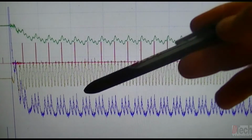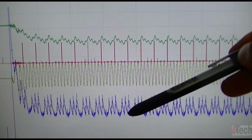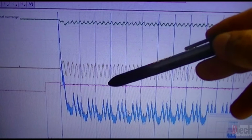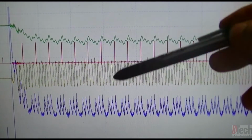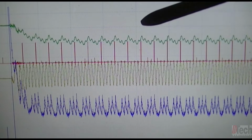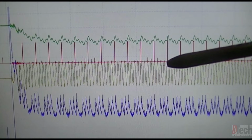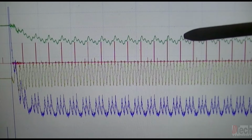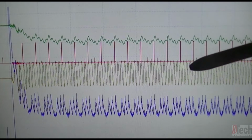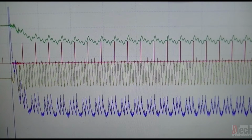Now, basic again, blue is relative compression. We have the missing hump from cylinder 3. Here is ignition sync from cylinder 1. Same exact thing. Missing hump for number 3. There we go. Same bad result. A burnt exhaust valve. And this is why I wanted to basically put this together to show you guys and to help explain. And again, as always, to help you guys keep this information in the back of your mind to not make incorrect calls when you're trying to diagnose with pressure waveforms.